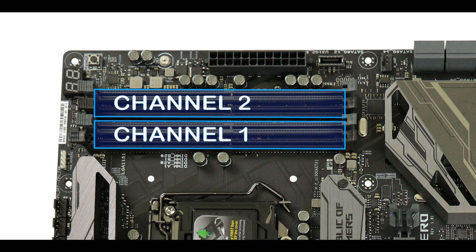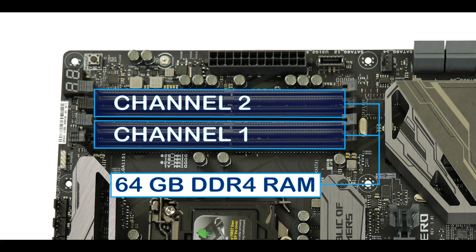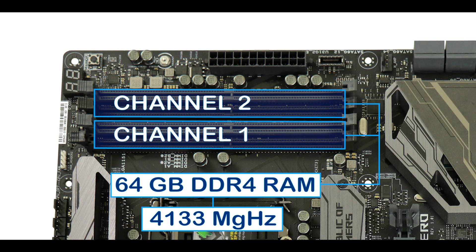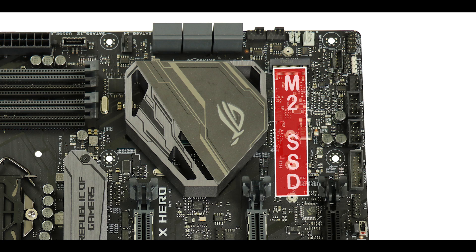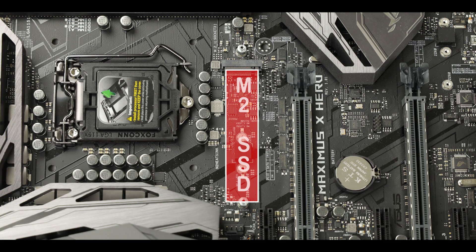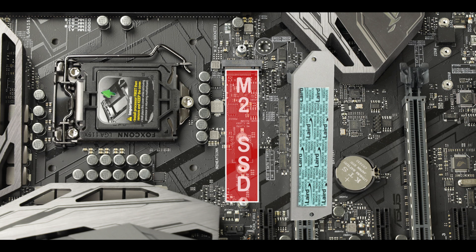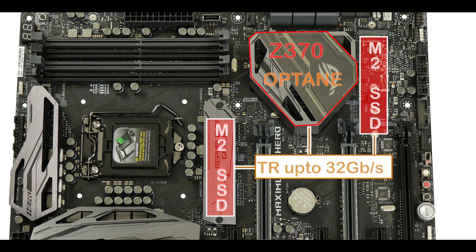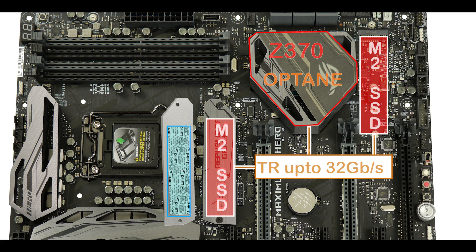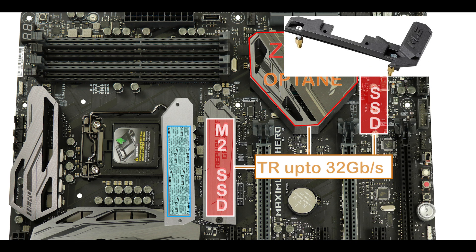RAM-wise, we have a dual-channel configuration which can run up to 64 GB of DDR4 RAM, overclockable up to 4133 MHz — that is a lot of megahertz, so make sure to choose your RAM accordingly. We also have an M.2 solid-state drive connector here supporting sticks up to 8 cm in length, and hidden under the heat shield there is a second M.2 connector, also supporting sticks up to 8 cm. On the other side of the heat shield we have a thermopad, which is very useful given that our Z370 chipset is Optane-ready — both M.2 drives can swap data at up to 32 Gb/s each. An optional 60 mm fan installable via the 3D mount will also help keep those sticks from accumulating too much heat.